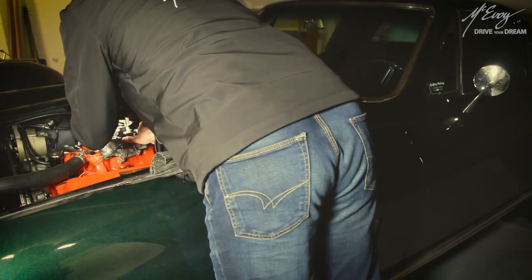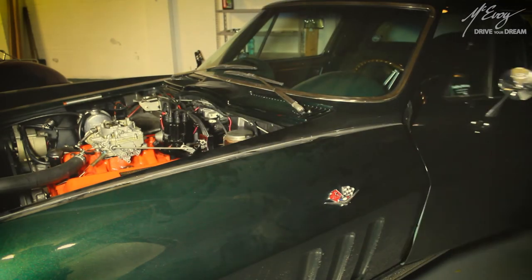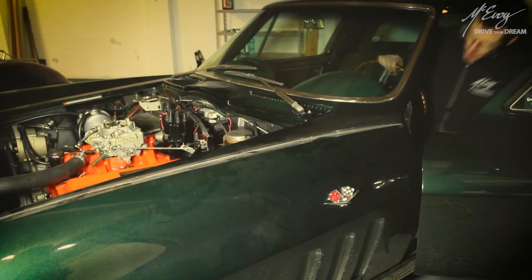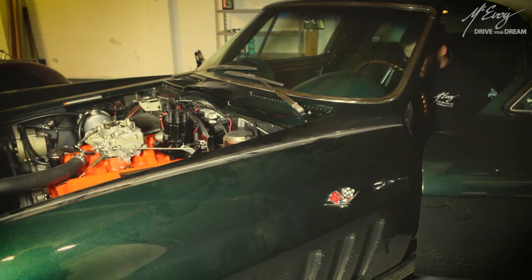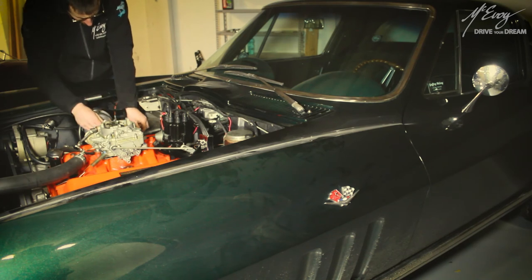Step 2. Check for fuel. Pump a heavy, juicy squirt of fuel down the carburetor's throat. It's fueling all right. More on that later. Let's give it another go, shall we? Damn it! Okay, we have ignition, we have fuel, I know we have compression, so start, old girl. Show me what you got.